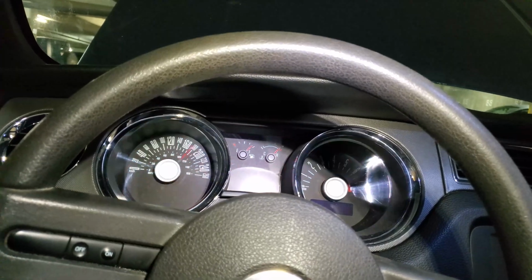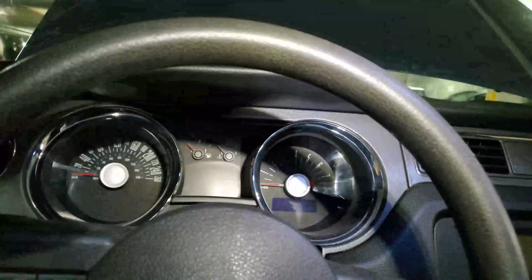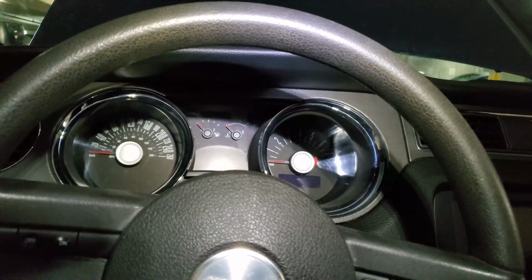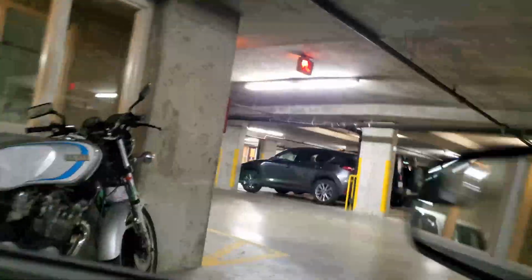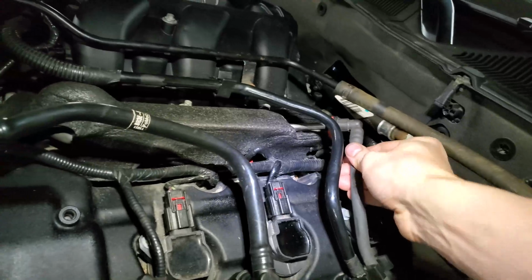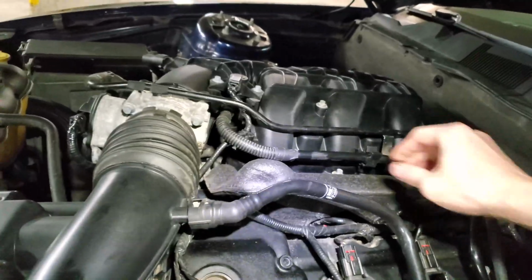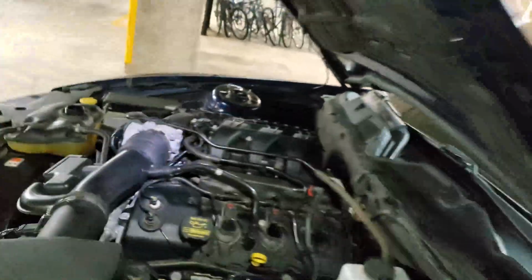There's that sound. I don't know if it was visible. This is a returnless fuel system, so not sure what good it does, because whatever air was in there just gets pressurized to 3 bars of pressure. But the air is still there. It's not gonna be cycled to the tank, as far as I know. And yeah, that's a high pressure fuel line. So there's nothing there. This is not a return line. I was mistaken. This is gas tank evap probably, and this is probably the evap valve, which I thought was a pressure regulated sensor.